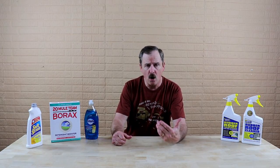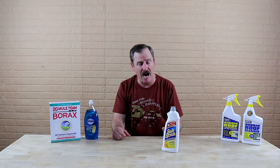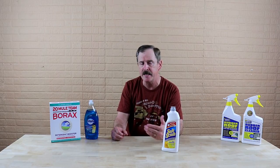In the event that you end up having mold and mildew on your rubber roof, there are a couple of different things you can use. You can use Soft Scrub, or you can use Tilex. Be careful with Tilex — work in small two-by-two-foot sections and make sure you're rinsing it off regularly. When using Tilex, make sure you're diluting it and leaving it on three to ten minutes. But Soft Scrub should work well.